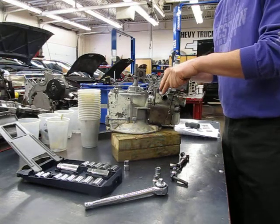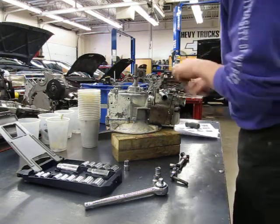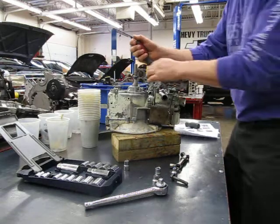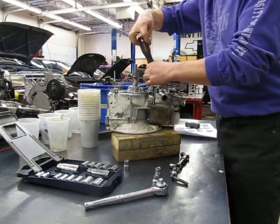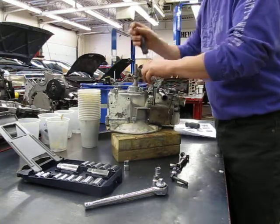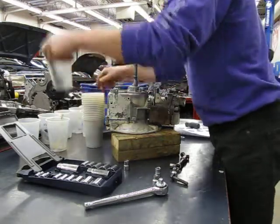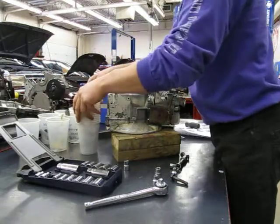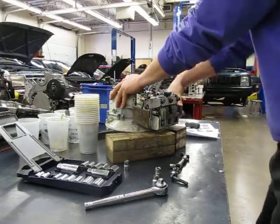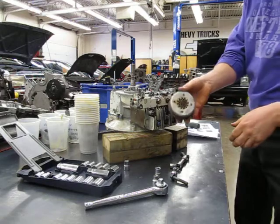I have this intake manifold — these were supposed to be quarter-inch bolts, but we've got some Robertson screws here. I have to improvise and get a Robertson screwdriver. On yours it should be quarter-inch bolts. This is the intake manifold — I'm going to have a separate cup for that. And then we have the exhaust muffler. Depending on how tight it is, you might be able to turn it out by hand; otherwise, you can use a pair of pliers to take it out.